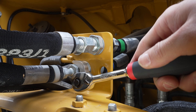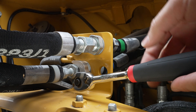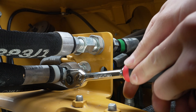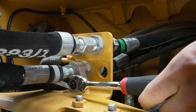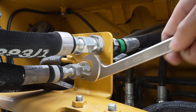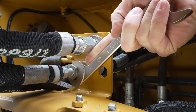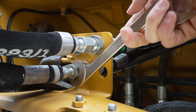The crowfoot works, but sometimes you have to fiddle a little bit with the ratchet to get it in the right position and then be able to apply torque. The flare nut crowfoot does fit over this line — it's a similar story where I have to move the ratchet around and get it in the right position. The angle head wrench is probably the ideal wrench in this situation because you can get a hold on this set of flats and get a second angle on the same set of flats with the other wrench head. With the long handle, I'm able to get enough leverage to break that fitting free.